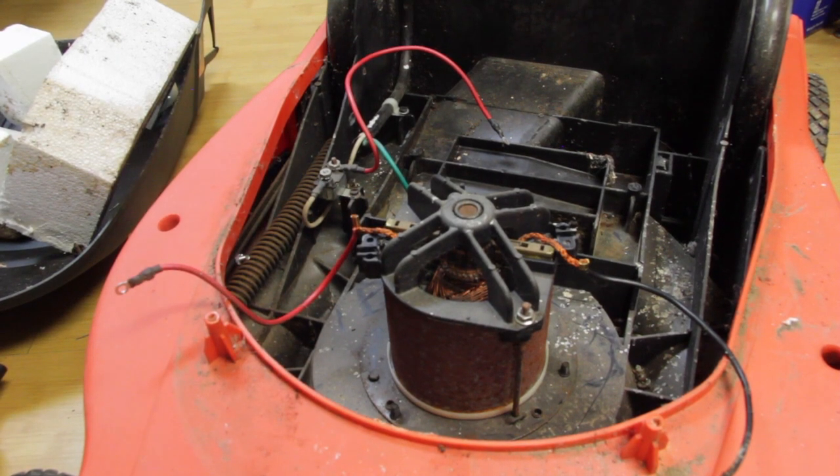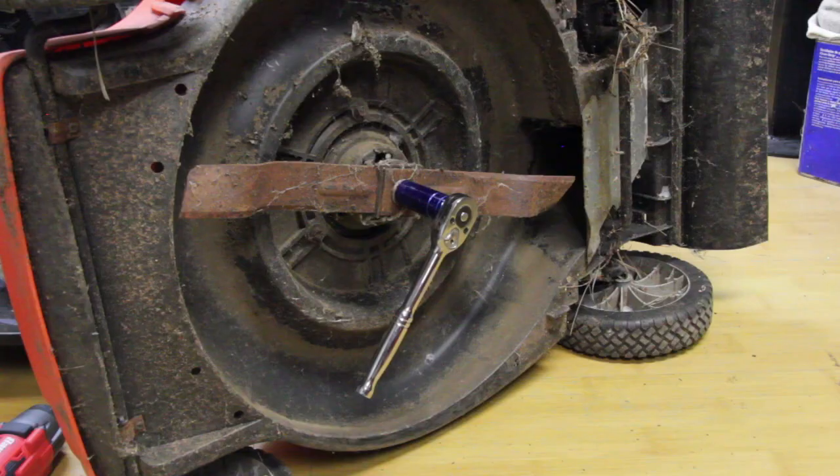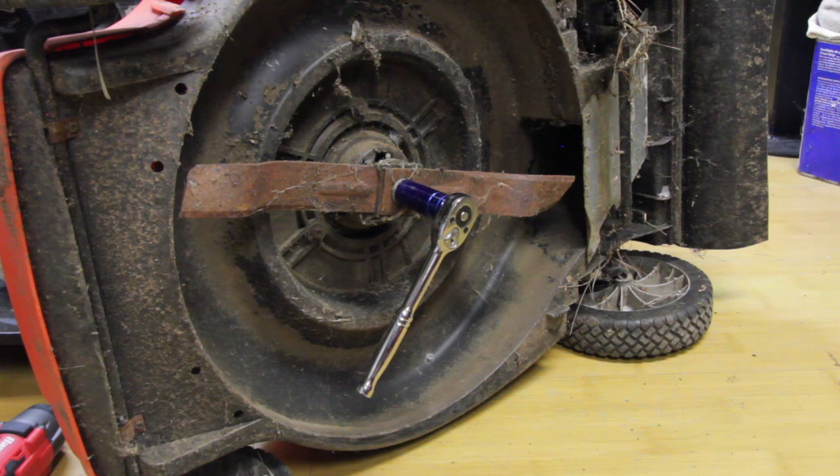To get the motor completely out, we have to flip the lawnmower upside down or at least on its side. There looks like there's one, two, three bolts in from the bottom, and then we'll also have to pull the blade off to get that motor out. Notice the first thing I did was disconnect that battery — even though more than likely it's dead as a doornail, we don't want any potential current going to that motor because I'm going to be moving the blade around. Always practice your safety: disconnect your battery before you do anything with a motor.